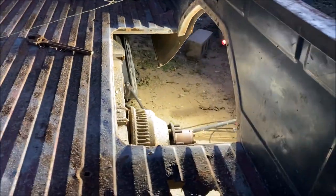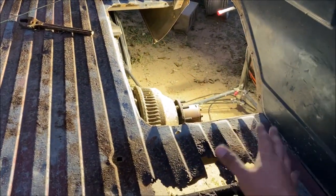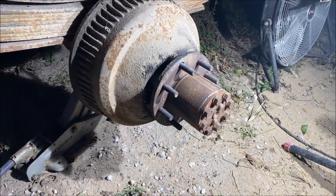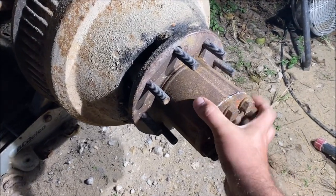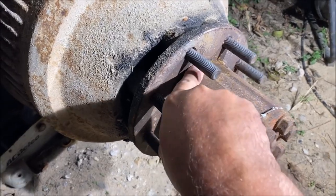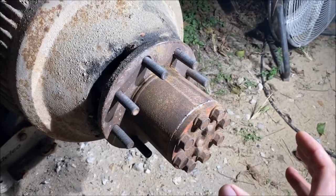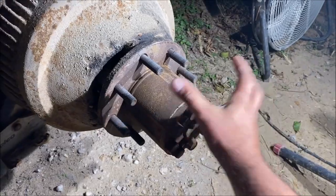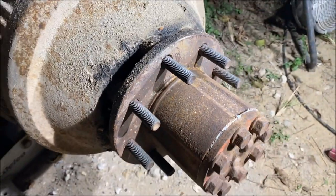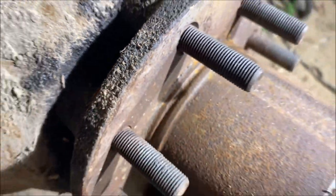I have a mini tub video coming very soon where we're actually going to mini tub that side — this side didn't come out so great, it's not an easy project, so stay tuned. One of the most important parts of this conversion is knowing your hub diameter. You don't measure it from the face — if you look back there it has two grooves because it runs two wheels. It can be very difficult to measure, so go online. This one is 4.56 inches.